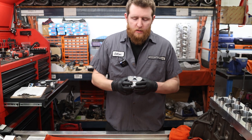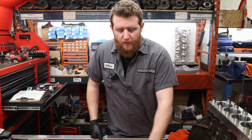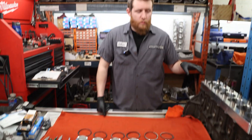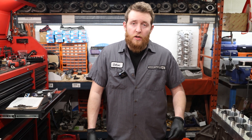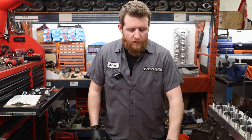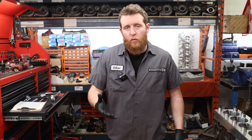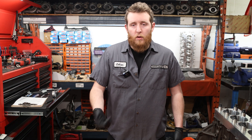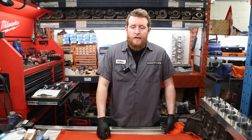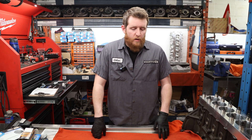We've measured our pistons individually and piston-to-wall for each cylinder. Not a lot of variance between these, so no need to mix and match. We're getting about three-and-a-half to three-eight thou clearance, which is very good. For ring gaps on this JZ — a street to slight high-performance build — we'll use bore times 0.0045, giving a rough clearance around 15 thou. We'll run 16 thou on the top ring and 22 thou on the second ring, which is six thou larger. They recommend four to eight thou; I like to run a slightly higher margin.